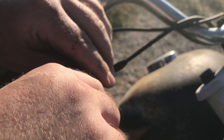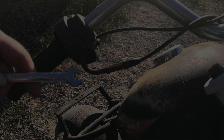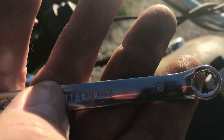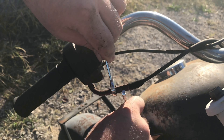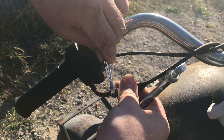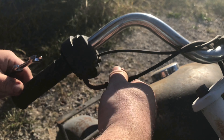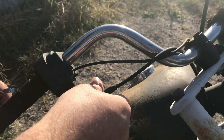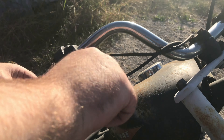He's pulling off and getting ready to disconnect the throttle cable. That's 10 millimeter again, and this one is an 8 millimeter. Hold one, turn the other — that holds the cable in place, and that's actually an adjustment you can make. That's the throttle adjustment there, and that's got to be released to release the cable so you can take all that loose.